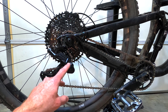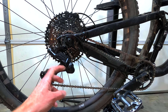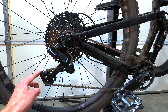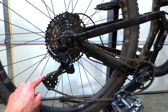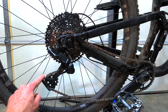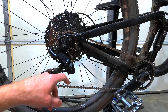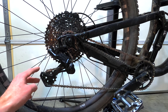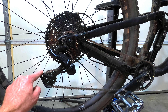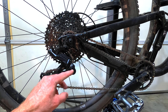The actual clutch is housed in here, and it's kind of like a ratchet wrench where it's a wheel with some teeth in it, and then pawls that go into that. One of the problems is that it leaves a dead zone before those teeth engage. You can see, just by me pushing on it here, the clutch is not engaging — this is all dead zone free play, as if the clutch wasn't even on. Once I get to a certain point and press harder, now the clutch is resisting, and then you can hear it click back as it went into those teeth. Sometimes this is worse than others.